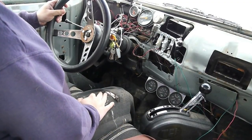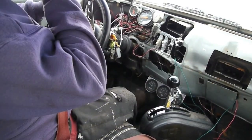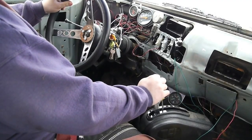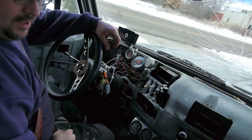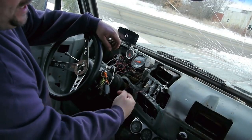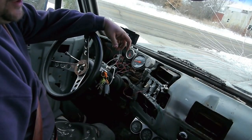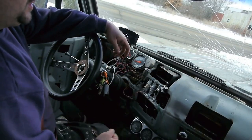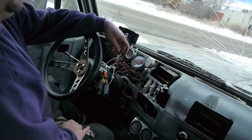When the transmission is in fourth gear with both solenoids on, the shifter linkage will control every gear except first. So if I want the truck in second gear, I can have the solenoids set for fourth gear. To control engine braking deceleration, you have to use mechanical linkage on the side of the transmission, just like a Turbo 350 or Turbo 400. You can use the mechanical linkage to decelerate in fourth, third, and second. If you want to decelerate into first gear, you have to have the solenoids set for first gear.